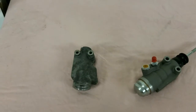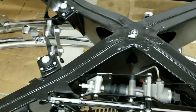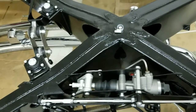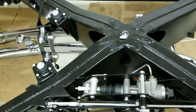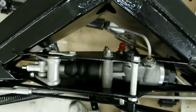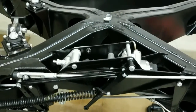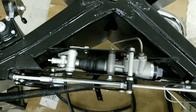Anyway, the cups and the pistons. To get the pistons out, a lot of times I plug up the holes with my fingers. I put a compressed air nozzle in one of them, and I shoot them out the end after soaking them several days in a liquid wrench type of material. So that kind of adds to a few things. I should also mention that on the pads I got from Post 55, where the clevis fits on the end, I had to grind those off a little bit to make the clevis pin fit, but it wasn't any big deal, just a little bit of material.